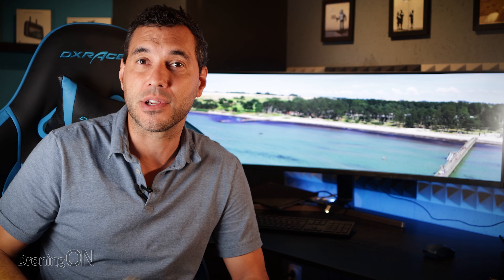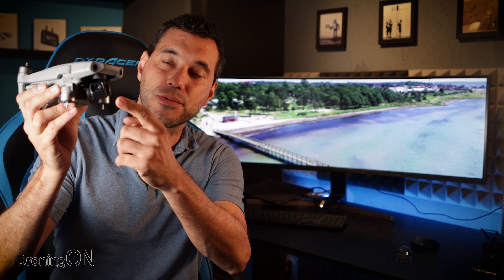However, if you've already done that and the problem is still not fixed, then I think we might have the solution for you here. When you're flying your drone, your vision is through the camera — the gimbal on the front of the drone. For the drone to appear to be flying in a completely straight line, the gimbal has to be pointing directly forward in line with the drone. But if that gimbal is slightly off by just a couple of degrees to the left or the right, you're going to get the impression that when you're flying forward, your drone is actually sliding in a different direction. So put simply, the root cause of why your drone is drifting can be as simple as needing a slight yaw adjustment on your gimbal.